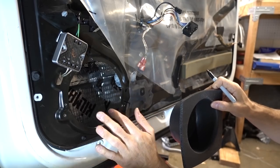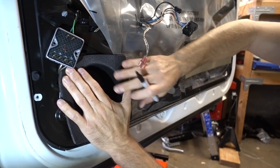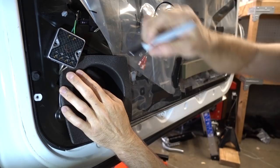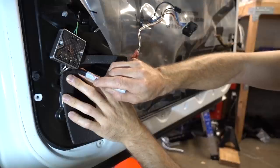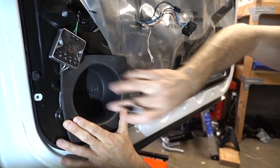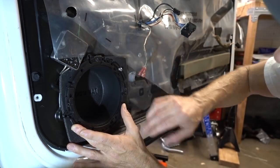I have the ring off and this hole is definitely bigger. Looks like it's going to fit no problem. But I am going to have to mark out a section here for this crossover. That fits in there good. Basically what's going to happen is when I screw everything back together, it'll just sandwich this in between everything and the speaker will be completely protected from the elements — and hopefully it'll give it a better sound. I made a little cut here for this crossover and everything is fitting perfect.